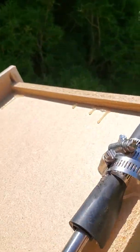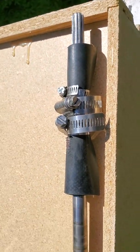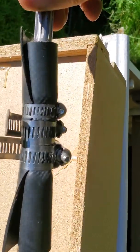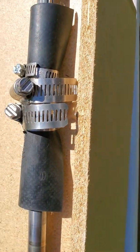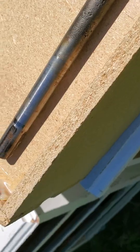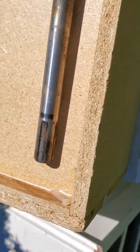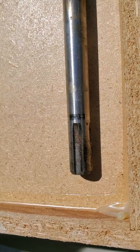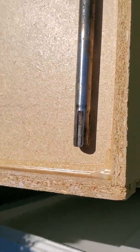Just some ideas for you guys — I know sometimes you can get in a bit of a crunch and don't really know what to do, but I found that this way worked excellent. I wrapped this rubber piece around about two or three times and then put on three clamps just to ensure it doesn't slide when you're hitting it, so all the force pulls down on the part that's in the power head. I'm planning to clean this all up with a brass brush and put lots of grease so it hopefully doesn't get stuck again.